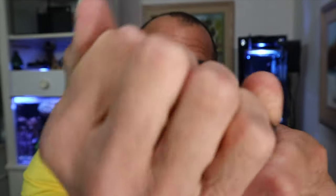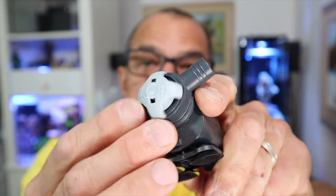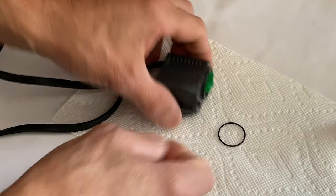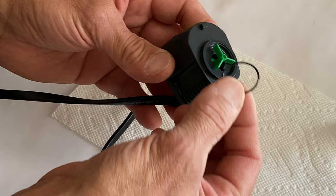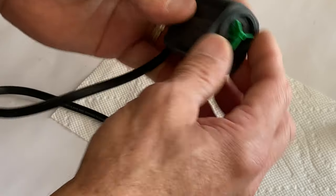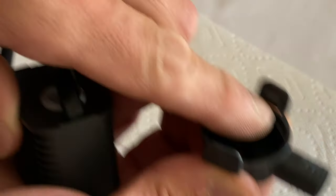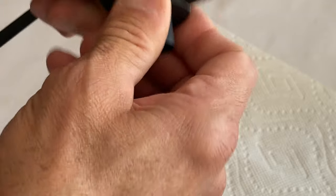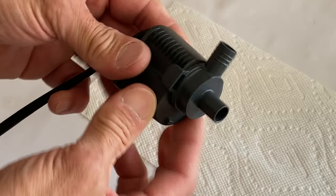This part pops off — not too easy, which is good. There's your impeller. It's got a controller to it, which is good in my case because I don't want much flow at all coming into my Pico. So what I've got here is I'm going to set it up to try the inline. It comes with a little gasket that gets stretched over this section. That ring gasket gets stretched over this part, which has these little teeth on it. You hook it in — we'll see if that seated all the way. It didn't feel like a good snap in. Let's go water test it.